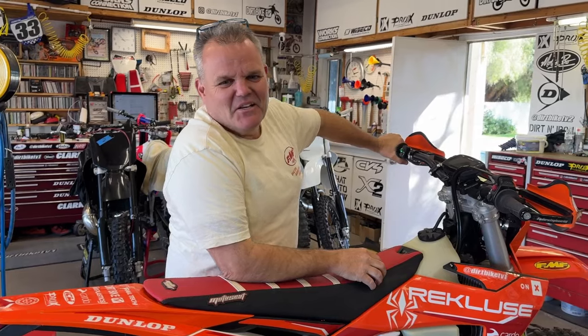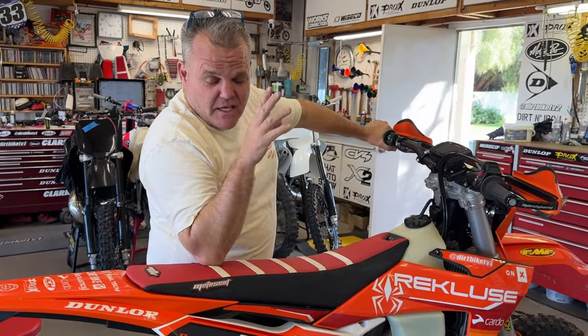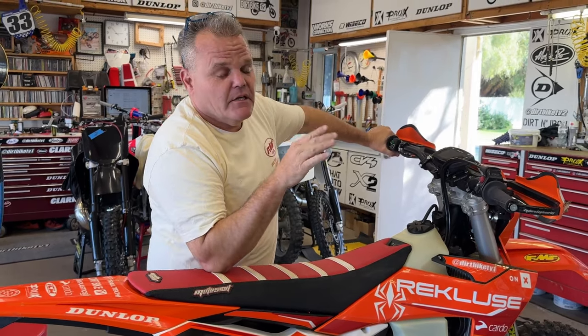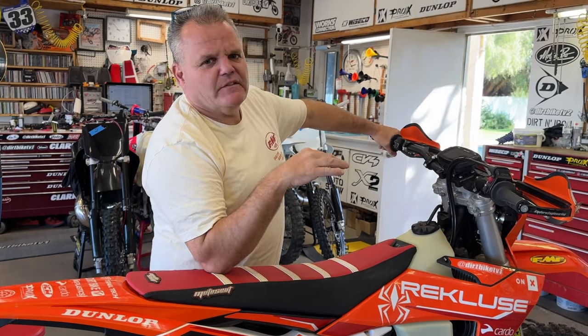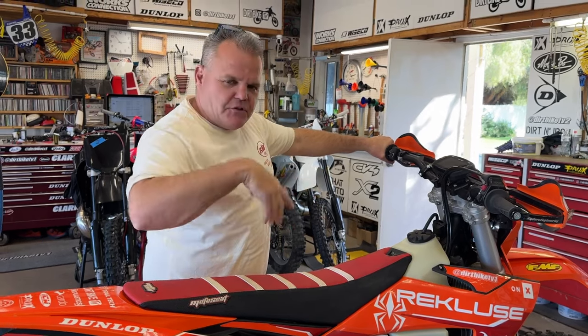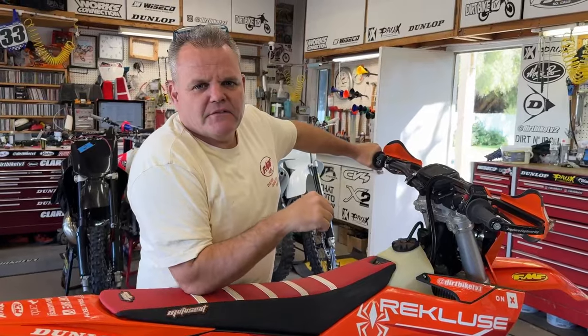Oh yeah. So that's our next step. We're gonna let it idle a little bit more here for a second. Guys are over paranoid about breaking things in. Don't let your bike sit there and idle for 5 minutes. Let it idle for 45 seconds to a minute and then ride it around at slow, I call it pit speeds. If you're at the track, just in the pits, just slow speeds, and then you can go get on it after a few minutes.